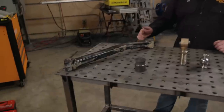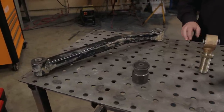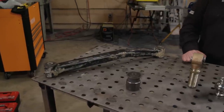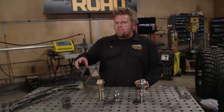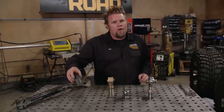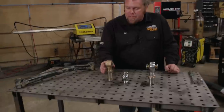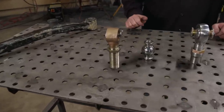The other downfall is that they're usually found in some type of fixed link suspension system, like this Jeep JK arm, which gives you no adjustability in your suspension at all. That's why you will rarely see this type of setup in any high quality aftermarket suspension system. Most aftermarket suspension companies now use this type of rebuildable rod end.